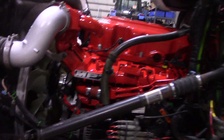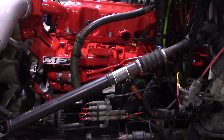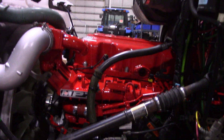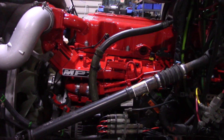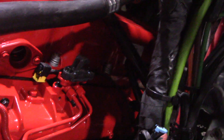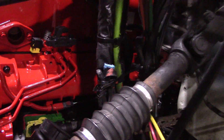I'm on this side of the engine finishing up the pipe work. I had to take all the pipes apart and clean them up - they were sooted up pretty bad, especially the intake. The intake was really bad. The actual boost and air temp pressure switch in the back of the intake was just so covered up it wasn't reading anymore.